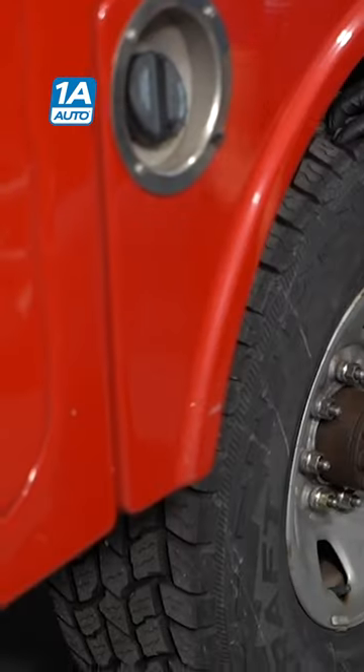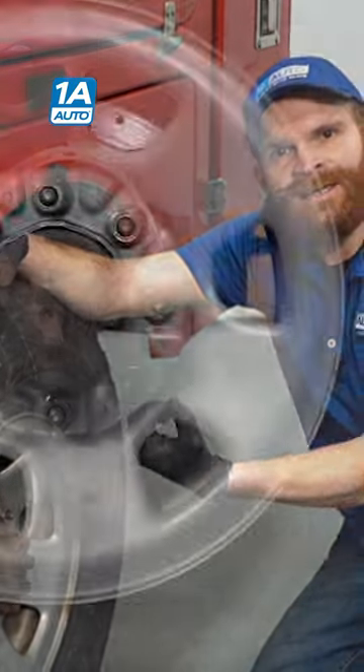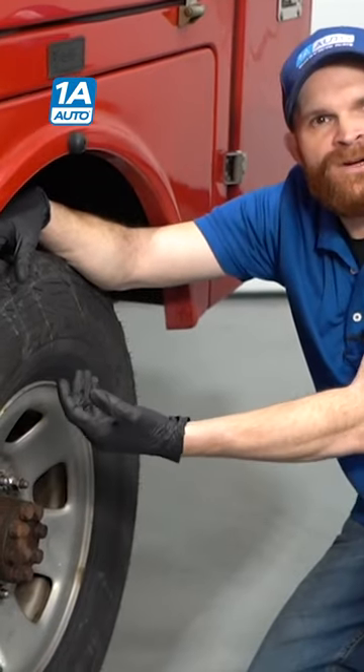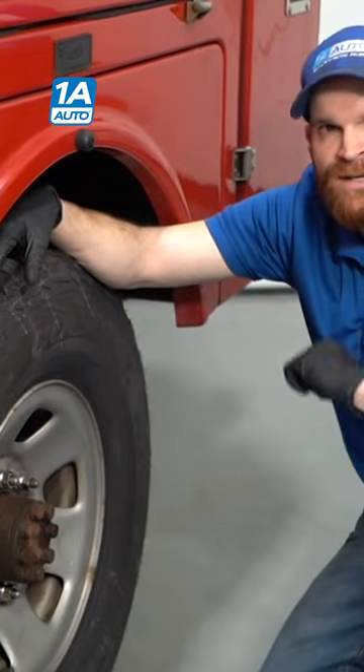In most cases, when you're working on a heavier truck like this, it's a more probable situation where the lug nuts are going to be under torqued. If these lug nuts aren't torqued, the brake rotor is not going to be tightly held up against the hub. So essentially, every time you're braking or even while you're driving down the road, that brake rotor could be moving around — essentially causing a brake pulsation. It's not going to feel very good while you're inside your passenger compartment.